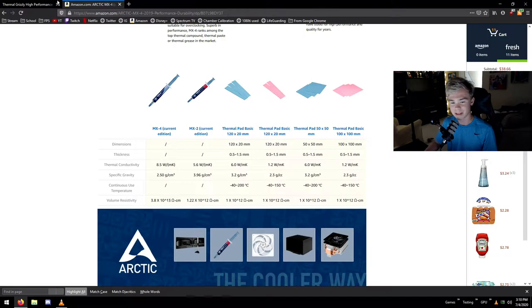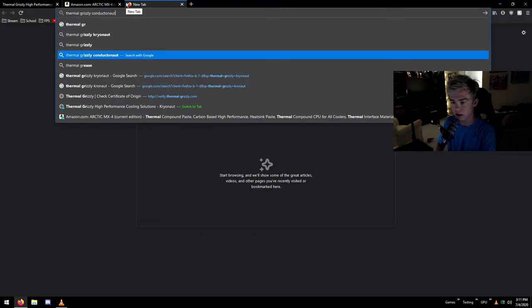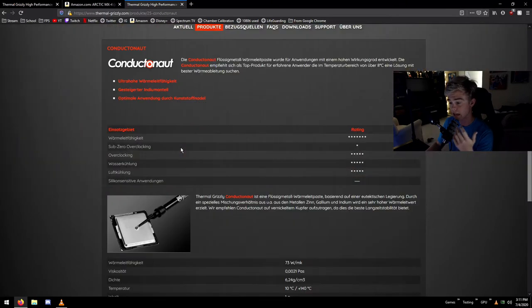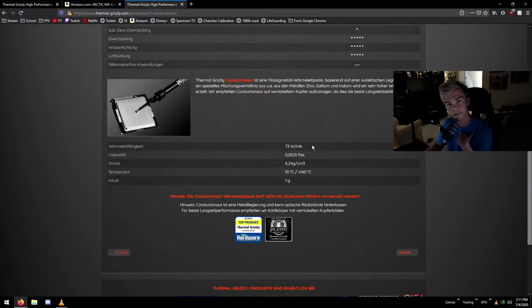That's basically how much heat it can dissipate easily. MX-2 is not as strong at 5.6 — you want a higher number. Then there's Thermal Grizzly Kryonaut at 12.5 watts per meter kelvin — that's not even a little bit different, that's just a big difference. And then there's Thermal Grizzly Conductonaut, which is literally not even a paste — Kryonaut is the best paste but Conductonaut is the best interface material overall. It's liquid metal; you spread it out with a little Q-tip. It can lower your CPU temps by a lot — you can delid an Intel processor with it. I wouldn't do it on Ryzen, or you can do shunt mods.